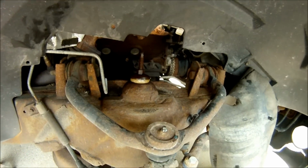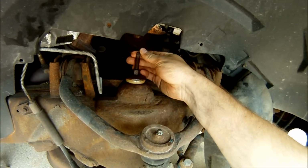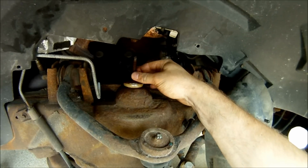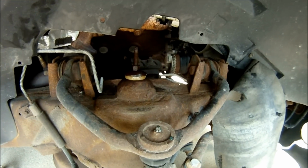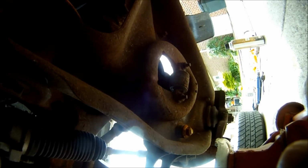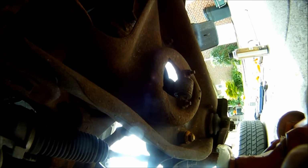I know that this nut is going to be a pain to get off of the vehicle. On the other side, I used a 15mm socket on here, grabbed the top with some vice grips, and ended up breaking off the top of the bolt. So I'm not even going to bother trying to take the bolt off. I'm just going to cut it off with a cutoff wheel. Before I cut off that top part, I'm going to undo these 2 bolts in the bottom so that the shock doesn't fall while I'm trying to take out those nuts right there. They're 13mm, should come off pretty easy.